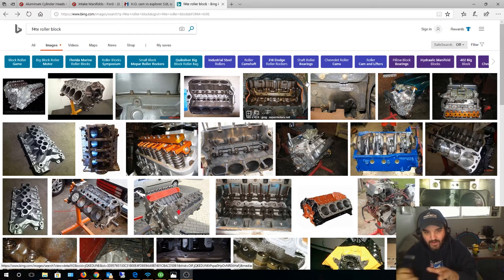With a truck or early Bronco, you want to build all your power down low — low mid-range — with lots of throttle response. I'm running a 351 Windsor and I've had four different engines in my truck, including a couple of race car engines. When I was younger I always thought race car parts were better, but after more research over the years I realized some of the best performance I ever had was with stock or near-stock components.